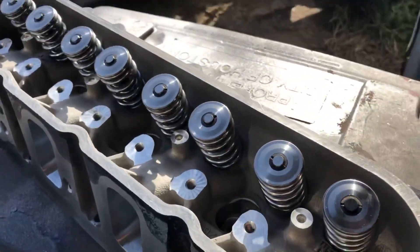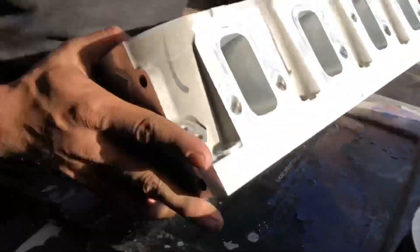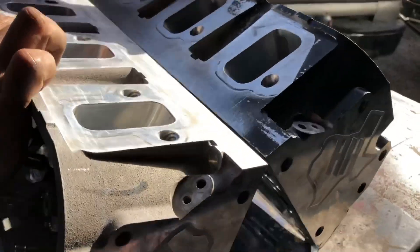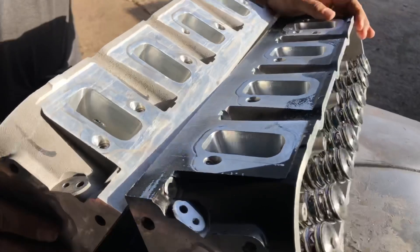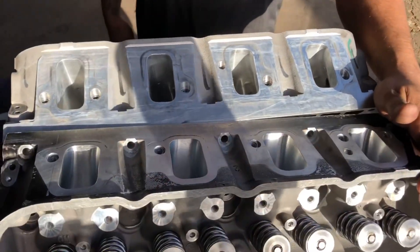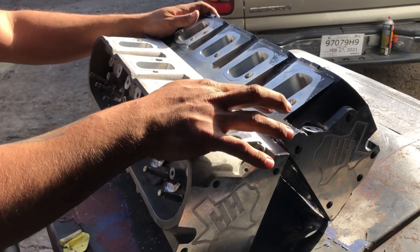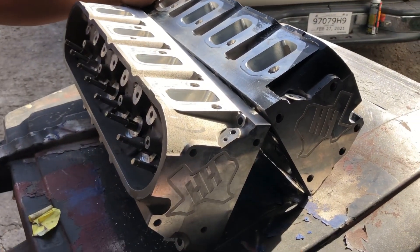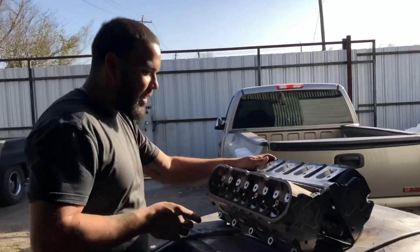This is another set — LS3 heads that we got done. This one is without the valve spring, still gotta put that on. Look at the size difference in the ports. Look at the size difference between these LSA heads and the LS3 heads — and these LS3 heads have already been opened up, they're not stock. And it's still way bigger. These LSA heads — if you were to port and polish, pulley your supercharger, and do the supporting mods, it's a thousand horsepower capable. Most definitely.